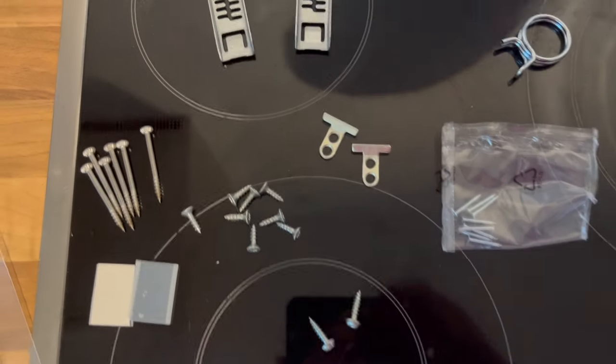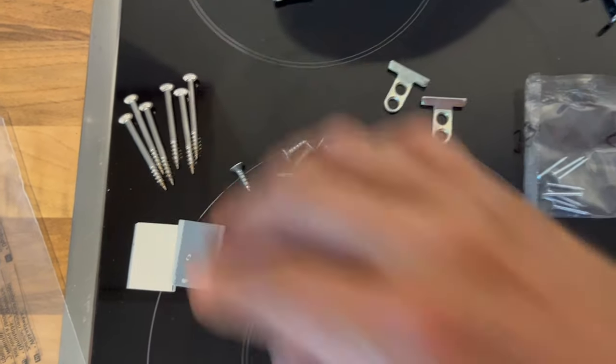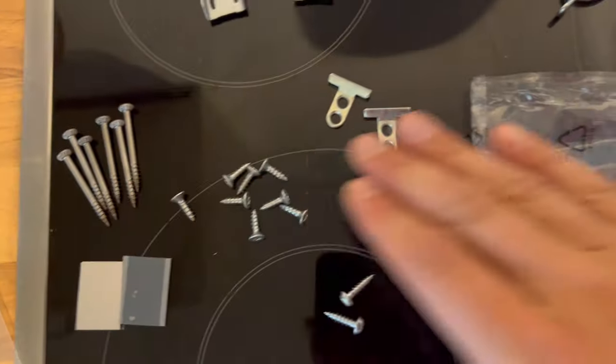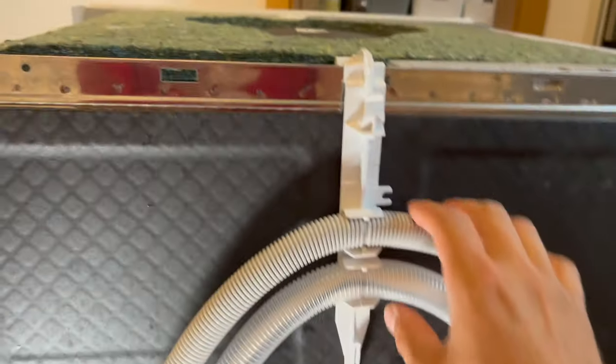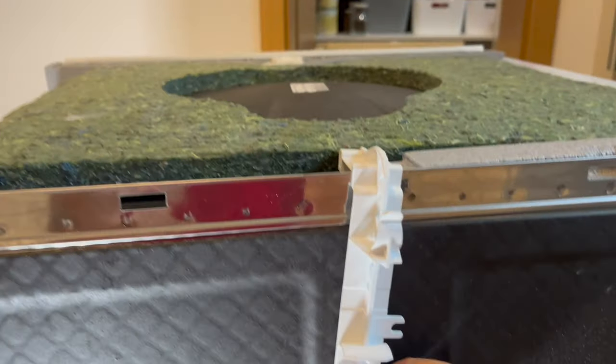Here's what the dishwasher comes with: some screws for mounting the board on the front, a power cord, mounting plates with their screws, and some other accessories we'll get to later. First, remove the hoses from the transport holder — you can discard that, it's just for transport. Then remove the hose with the aqua stop.